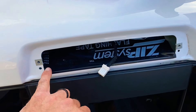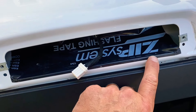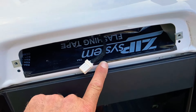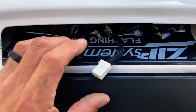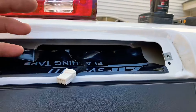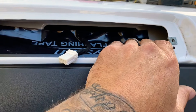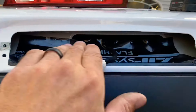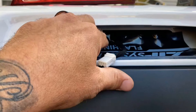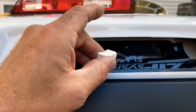First step: cut a piece as wide as your opening from here to here. You're gonna stick it on about a quarter inch onto the paint — make sure you clean it first so it sticks nice. Press it on. I do this with one hand but I'll show you: you're gonna go in kind of pitched up just a little bit, then stick it to the back, cover the hole. Push your plug in first, then put this on, make a slice, pull the wire out so it looks like this.